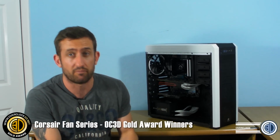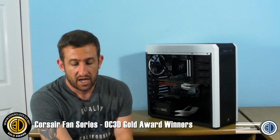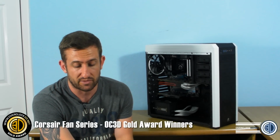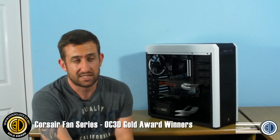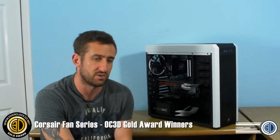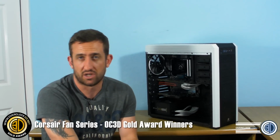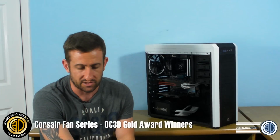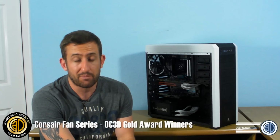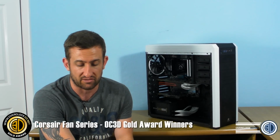So on the H100, I've tested a few fans. If you go with the Corsair original fans, 64.8 degrees average temperature, and then your delta temperature was 45.2 degrees. This is with the 3960X at 4.6 gigahertz, 1.425 volts, after Vdroop dropping down to about 1.41. Same motherboard, do you know what I mean? Not a problem, been there, done that loads of times. So that was the Corsair originals. The NF-F12s were about 1.2 degrees warmer with a 66 degrees average and a 46.8 degrees delta temperature.